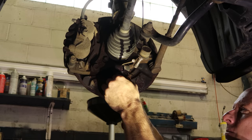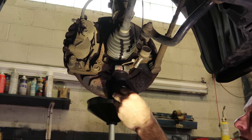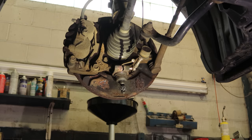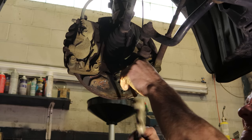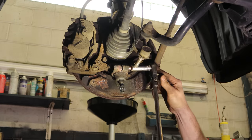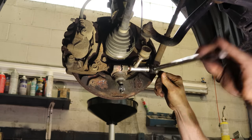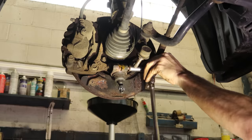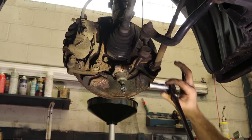So we cleaned all that rust out of there and we'll tap our new ball joint in. I also hammered a chisel into our knuckle there where it's split — that holds it apart a little bit, makes it easier to get all this stuff in there. We'll start our bolt a couple of threads so we don't end up tearing it up with the actual tools. Now that the ball joint is in there and our bolt is started, we can tap out our chisel and start tightening up our bolt. We're not going to use any power tools on this — I don't want to break that bolt or strip out any threads. We'll throw a little grease in there to make it easier on the next guy.